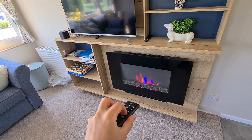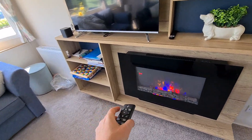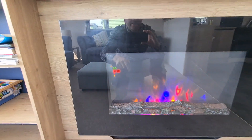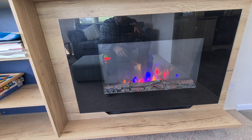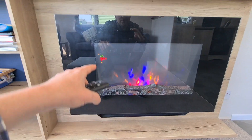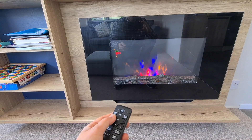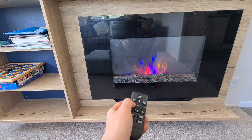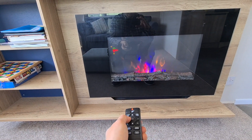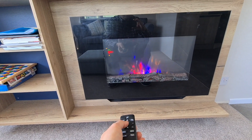What you need to do is press whether you want 1,000 watts or 2,000 watts, depending on how fast you want the heat to come on. Press once and as soon as you see one red dot, that indicates 1,000 watts and it will start heating up. However, because the target temperature is already 22 degrees, the heating won't come on — you would need to use the plus and minus buttons to increase the target temperature above the room temperature.